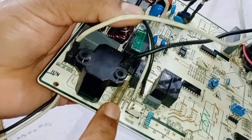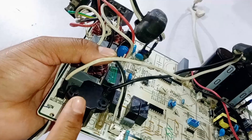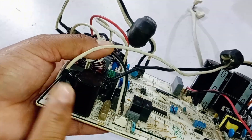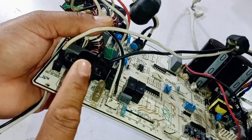One supply comes through this fuse, but the phase also passes through the PTC sensor. If this sensor fails, the circuit board won't turn on. You'll need to check its resistance value with a multimeter. If the resistance value is between 45 and 50 ohms, the sensor is fine.